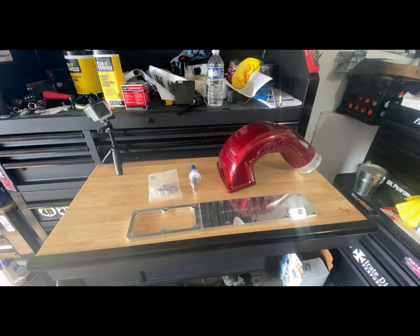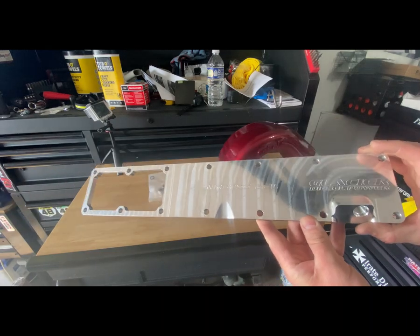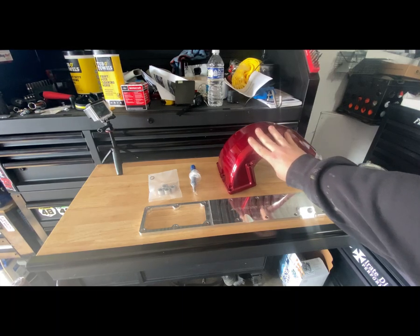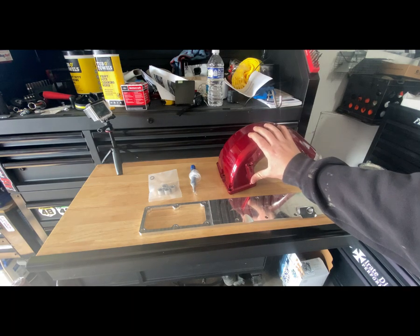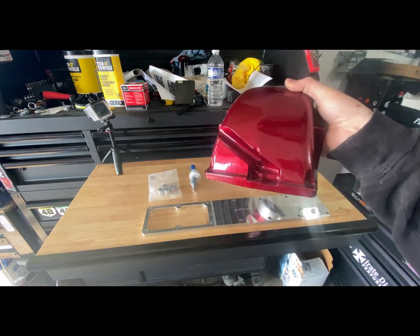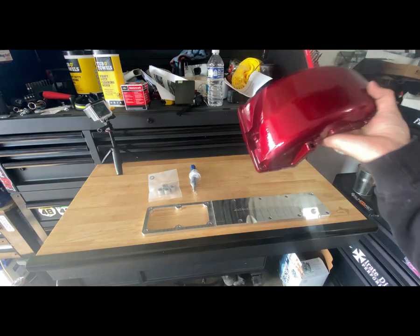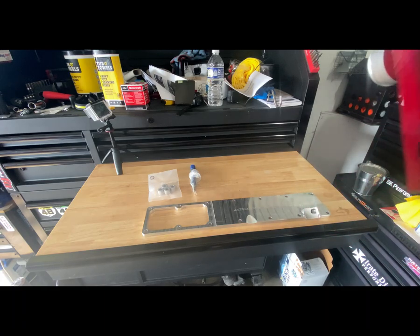So here's what I went with. In my opinion, Glacier Diesel makes some of the nicest grid heater plates and the nicest factory-style intake horn. There's a whole bunch of them out there — eBay specials you can get pretty cheap — but these look the best in my opinion. Obviously powder coated, illusion cherry, leaving this one just raw aluminum. These things are pretty nice. They come with a cast-in relief for the number one injection line. I will say the Banks manifold is a little bit more well-engineered simply because they supply you with a number one injection line.